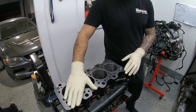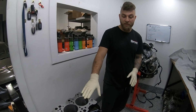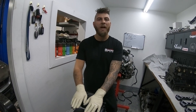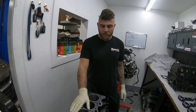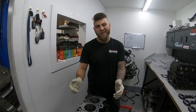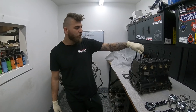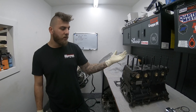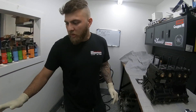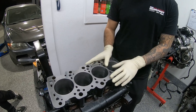The blocks are both at 5 RA smoothness. The heads are essentially the same, though we still haven't gotten them back. Both are drilled and tapped for half-inch head studs. I'm going to be using the Boost and Performance Demon Spec 1200 L-19 half-inch head studs. Jeffrey is using the 2000-grade head studs — still half-inch. So both these blocks are set up for half-inch head studs.